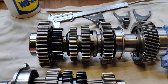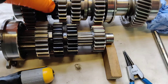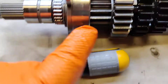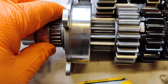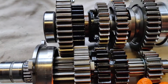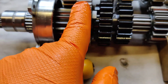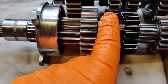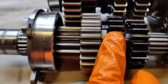If I line up the output with the input shaft I can show what I mean. Looking at where the wear is on first gear, that's actually on the input shaft itself — it would kind of line up there. So first, fifth, fourth, third, second — third and fourth on the input slide together so those dogs line up.